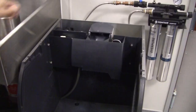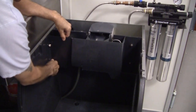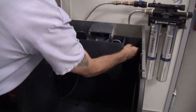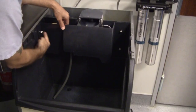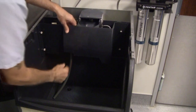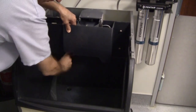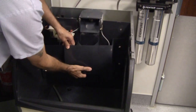You can see this inner panel that needs to be removed. I'll take off these screws — apparently they just loosen and stay on, they don't come off 100%. The panel won't come down on its own. There's a tube connected underneath, so you need to wiggle while pulling down this tube right here, then this panel will just drop right down.